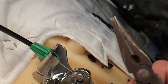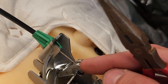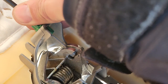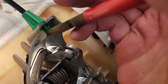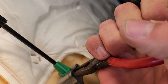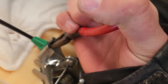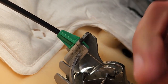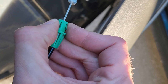The last thing to do is disconnect the door handle, which is quite easy. There's a small ball inside with two tabs to push down. What you want to do is press with the pliers onto these tabs, then pull the cable out, and once you remove it you can detach the ball and detach the handle. The idea is: press the tabs together, pull out the cable, and detach the door handle.